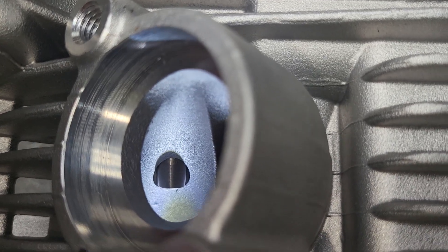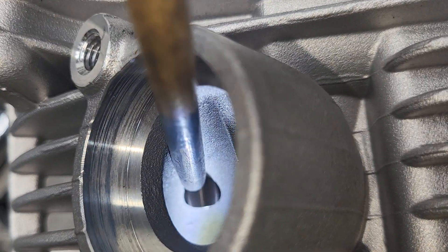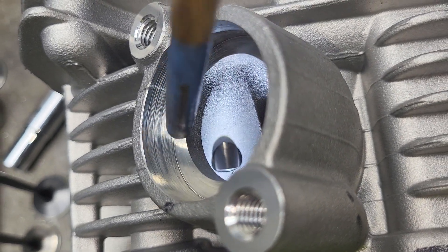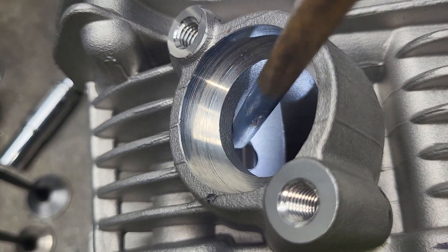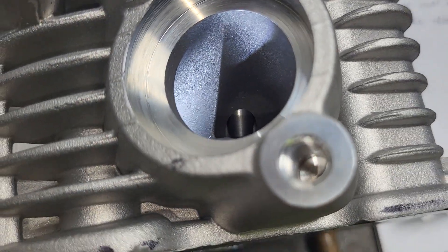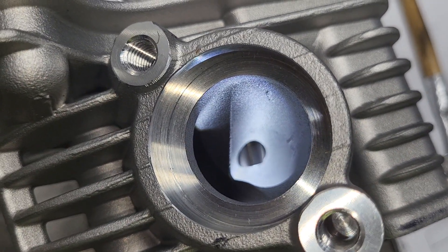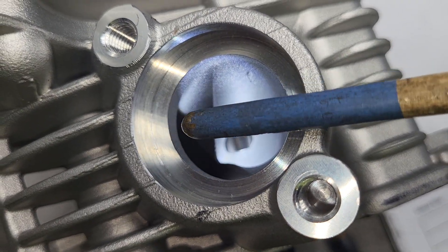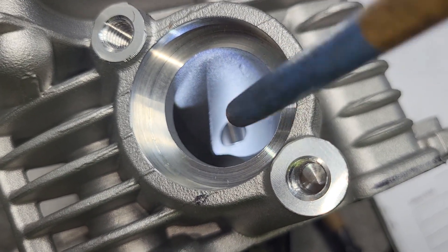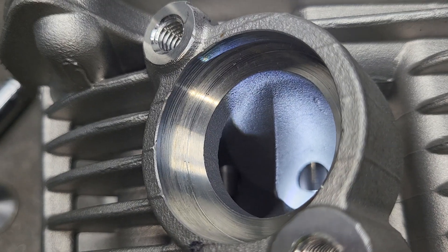We've got a real sharp transition there. This wall comes out at this angle. So this sharp edge here, we can do some serious radius work there. Right now the way it's designed, it's aimed right at the other exhaust path. The other exhaust path is really nice — it's straight, no problem. The problem is you have this air coming in, so they're both coming out and they're banging into each other right here. If I can do something with that radius and make it so they can exit smoother, that would help at the real high RPM.